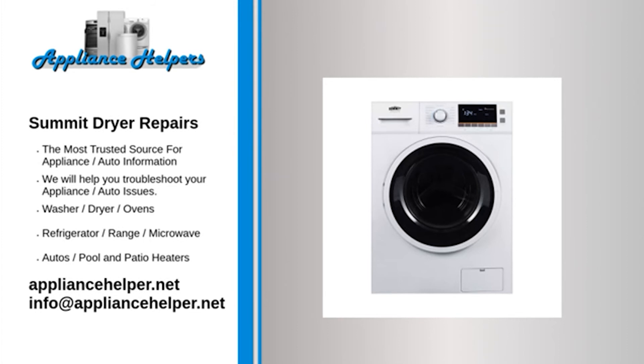If your clothes come out wrinkly, make sure your load is large enough to fill the drum to two-thirds of its capacity. If it's not full enough, it will toss clothing around more than it should and cause the unit to extract too much water during the final spin cycle. If your clothes feel wet after the dry cycle, because combination washer-dryers use condensation drying, everything may seem damp initially. Take items out one by one — if they don't feel dry within 10 to 15 seconds, place them back inside to continue the drying cycle. Use the self-cleaning feature once every 6 months to avoid soapy residue and buildup.